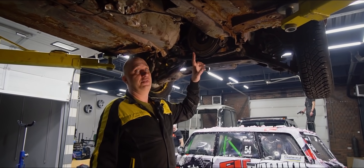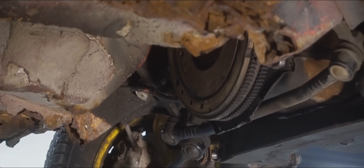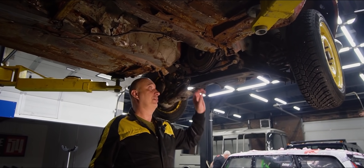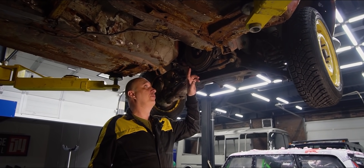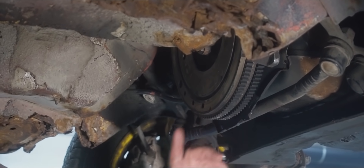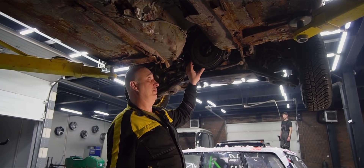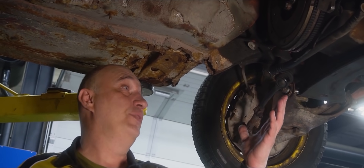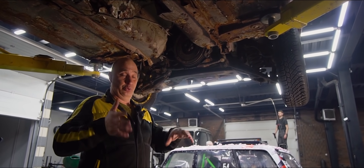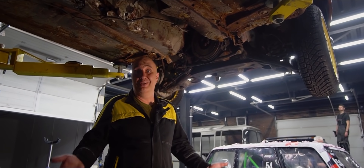We are looking very good. We've bolted on a second flywheel — we just needed to use some longer bolts. They were way longer than we needed, so we had to put a few washers in there too. These do need to be bolted down tight. We've got them perfectly centered. Right here you've got the pins that center the clutch pressure plate. These are high quality, so everything worked out very nicely — they're perfectly on center. We've got two of them on there. Why don't we bring her down, fire up the engine and give it some gas? See whether the engine is smoother to operate, or perhaps it'll be tougher to start.